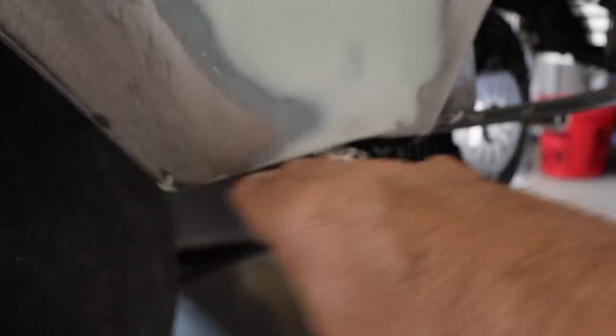Here are the fenders with the flares. They've been sanded a lot and are very smooth. The darker green is the fiberglass filler in the more structural spots, and the lighter stuff is the Evercoat Z-Grip filler. I've got a couple of things to address — like this little dip here — that's got to be body worked. I need to do a little hammer and dolly work to smooth it over, weld a little spot, and make sure this section is even for the bumper to go on.